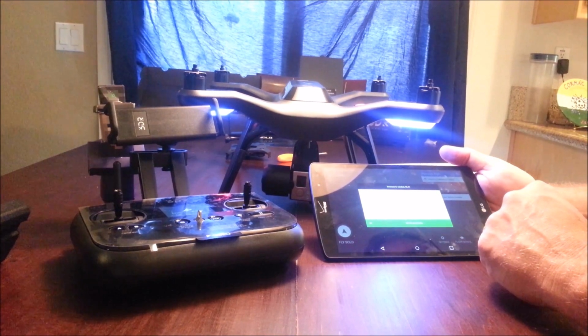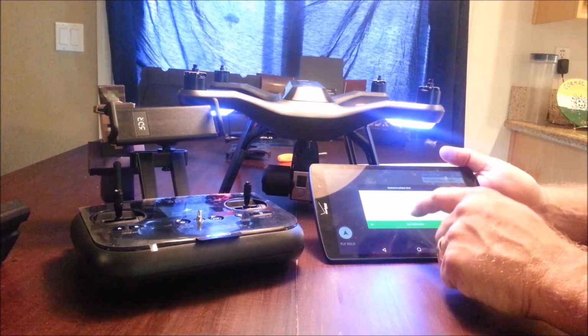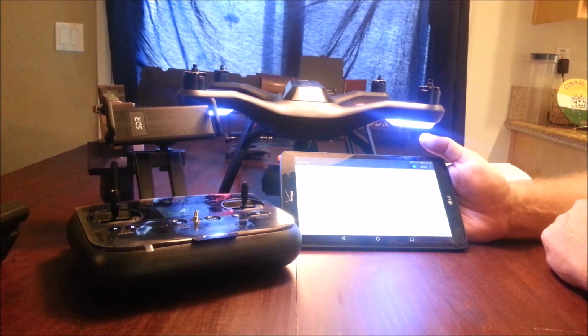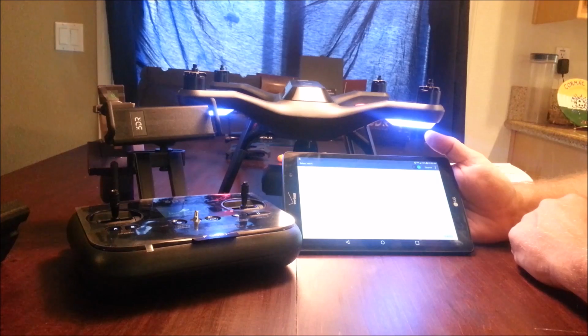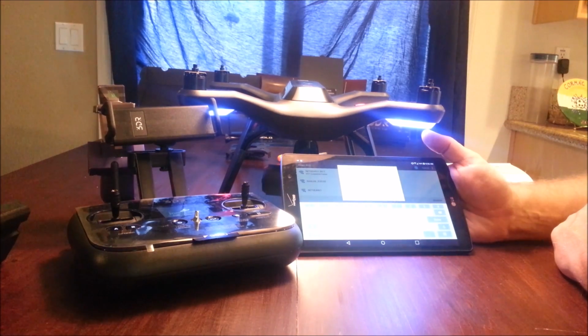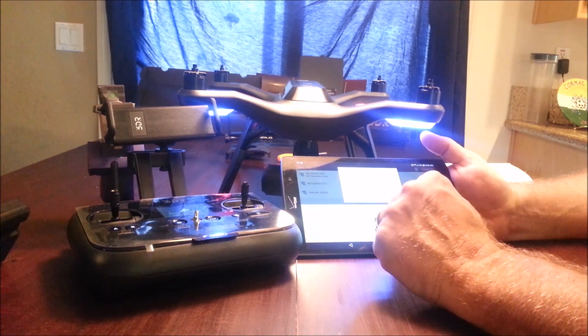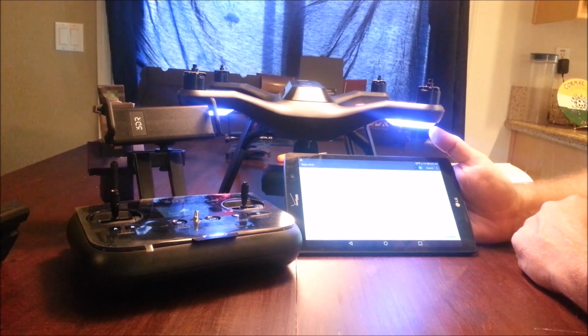Go to your phone's Wi-Fi settings, find the controller Wi-Fi network, and connect to SoloLink, enter password SoloLink. So go to settings, turn Wi-Fi on. Okay, so Wi-Fi is on. It's seeing all the different Wi-Fis we have in our neighborhood. We're going to search. SoloLink, here we go. Click on this. Password is, guess what? SoloLink. Connect. It's saving it. This tablet is going to be purposed for just this 3DR. So we've got an audible connection and vibration that says we are connected to the Solo.